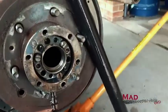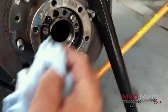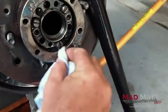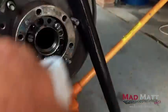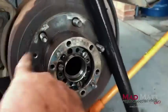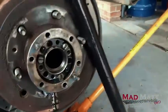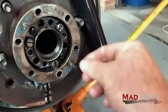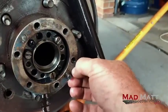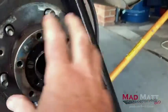That's my theory on it, be it right or wrong. It seems to work as a general rule, other than when I had the axle out the other day I must have had some oil left on the surface and the RTV didn't seal, so I've got that little oil leak which is what I'm fixing today. My tip: don't run a gasket - run RTV, some sort of oil-resistant silicon sealant.